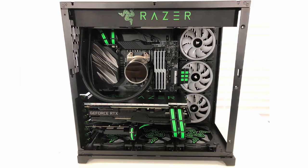The most controversial choice was having the fans at the back of the case as exhaust. Air came in the bottom as the only intake, hot air from the GPU exhausted out the back, but that didn't leave a lot of fresh air for the CPU — good GPU temperatures but potentially worse for the CPU. This case has been tested extensively on YouTube; Canuck's video compared all configurations and found that the best balanced setup was bottom fans as intake, back fans as intake, and the AIO at the top as exhaust. I had deviated from that for aesthetics.